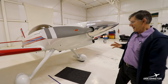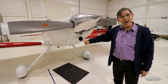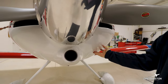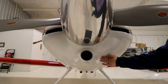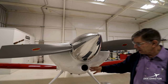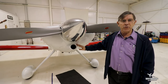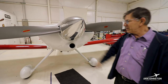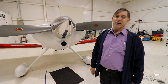Now that we're at the front — I have ram air. It's got filtered air I use below 2,000 feet, but I also have ram air with a butterfly valve controlled from inside the cockpit. I can open it up and it gives me about two to two and a half inches more manifold pressure. So going up high, you've got all the power you ever want.